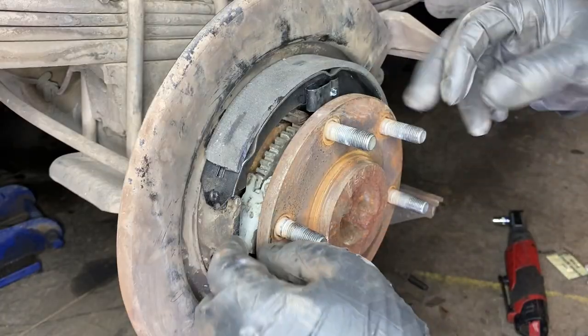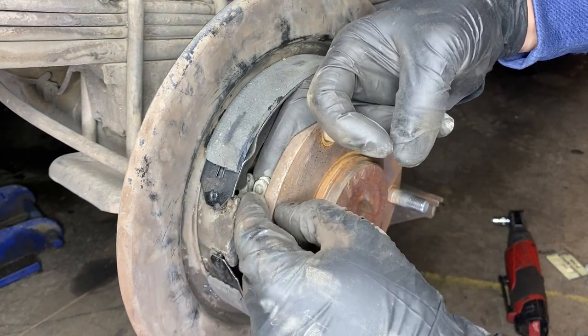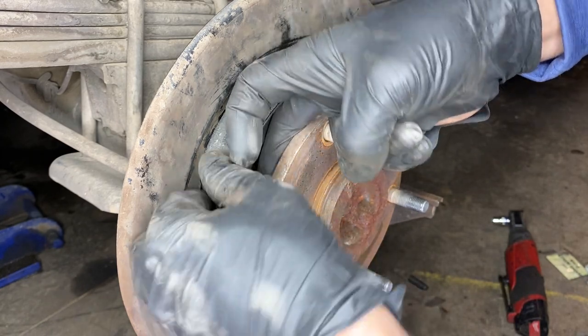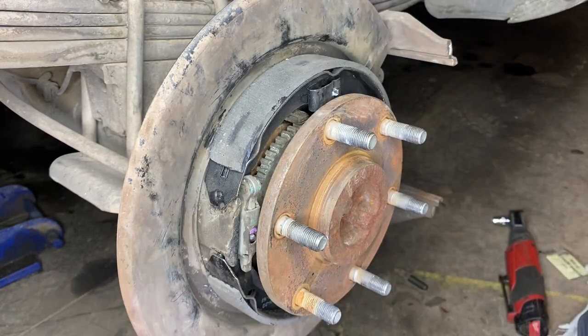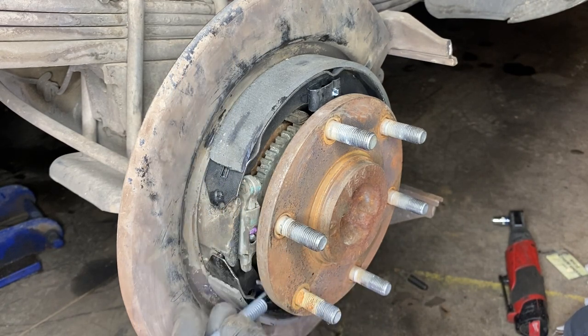This part can be a little bit tricky — let's get this toggle lever and put it in place. Make sure the brake shoes are right in the little crevice of the toggle lever; it needs to be right in place just like that. Now let's go ahead and get our spring set in place. This one is a little bit difficult because it's pretty strong.